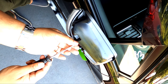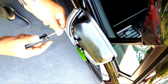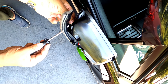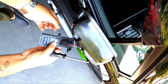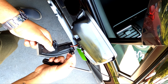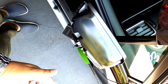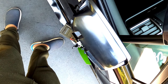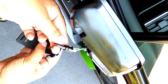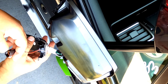Press that clip, it's very simple — just press the inside right here and take it out. Your mirror is out, super simple. Then you come around to one Phillips head screw here — don't be scared, it's child's play — and one to the bottom. Don't lose these screws. Just let it hang. Now this is the connection for the turn signal — disconnect that, just unplug it.